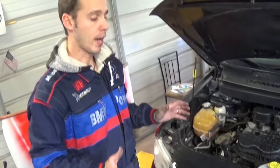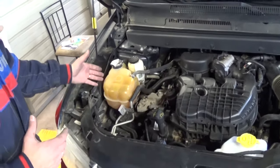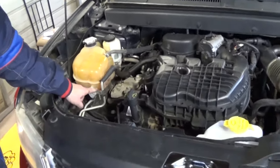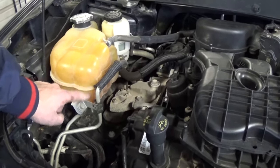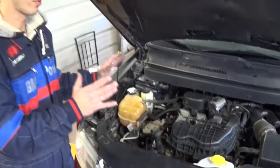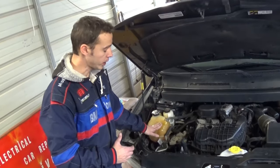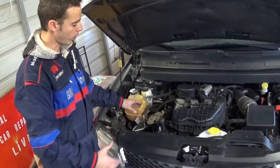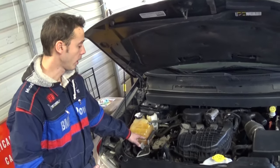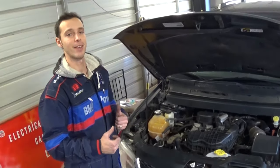Okay, we're out of the car. The coolant is extremely hot — never open the overflow bottle right now because it will severely burn you. It's almost 230°F. You can see the level went down — it was all the way up here and now it's lower. We're going to let the car sit overnight for about 10 to 12 hours until everything is cold. What happens is the pressure in the system and any air pocket will be replaced with coolant as the car cools down. Later, fill it up to the max when cold, drive a short distance, keep an eye on the temperature gauge, and you should be good to go. Thanks for watching — see you guys next time.